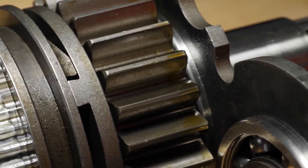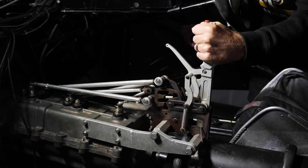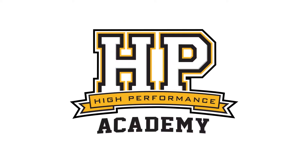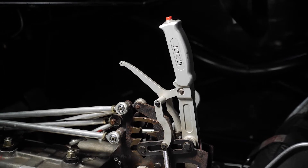While dog engagement gearboxes are commonplace in a lot of forms of motorsport, when it comes to drag racing there's a slightly different twist taken on the dog engagement design. This is what's often referred to as a clutchless manual gearbox. There are a few manufacturers making these gearboxes, such as Liberty and G-Force, and what these allow is a seamless upshift with no interruption to the engine power.